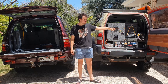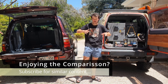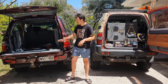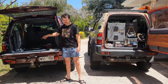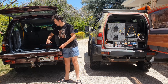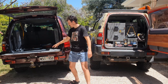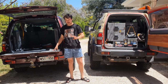In my Prado I've utilised the barn door as a table. If you have a double barn door, you can have a little table, a slide-out sink and all these extra things. With the tailgate, the main mod upgrade you can do is take the carpet off, cut it out, and you can get those custom doors — common on the 80 Series Land Cruiser and Hilux as well — with two push-up pins that pop open so you can put your recovery gear in there.